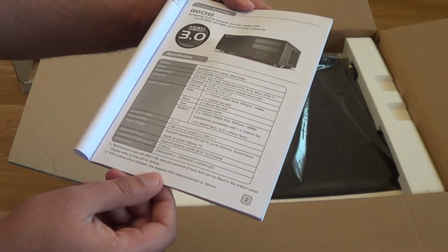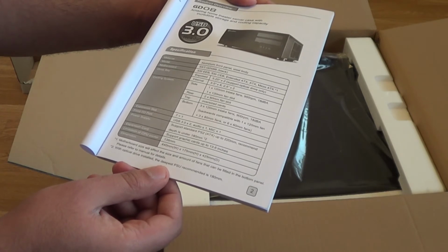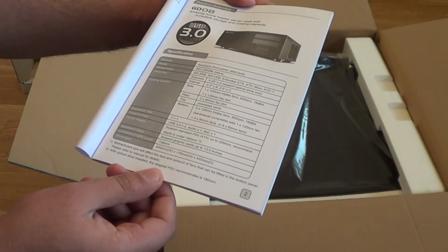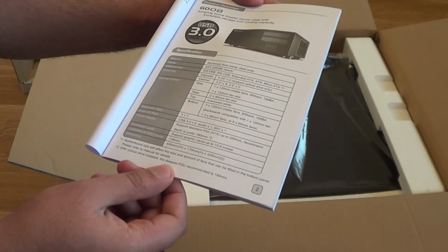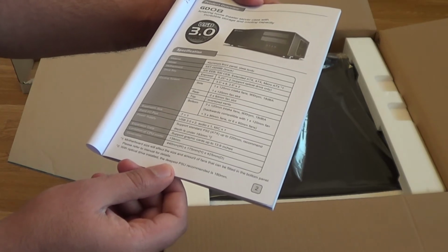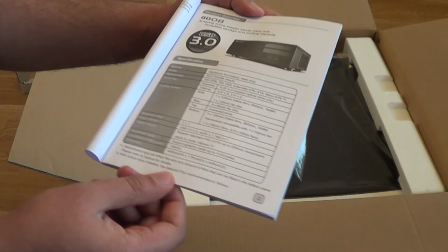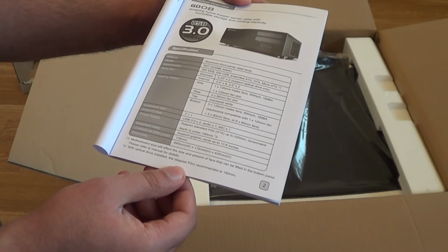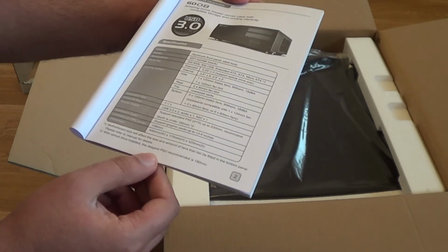It's got 7+1 expansion slots. The front I/O has two USB 3s, audio and a mic. Power supply supports a standard ATX power supply of up to 220mm. Recommended depth is under 180mm. Expansion card support for graphics cards up to 13.6 inches. Limitation of CPU cooler, 138mm in height. I mean, this is really great information. So when you have this case, you know exactly what you cannot go out and buy.